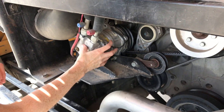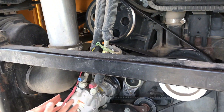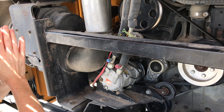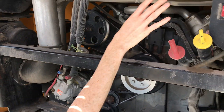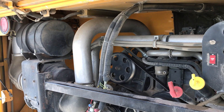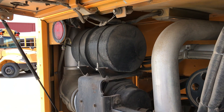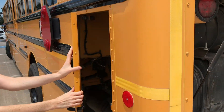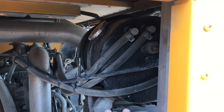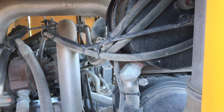While we're on the air conditioning compressors, we can also look at the hoses here — those are secure and in place, no leaking, no loose parts, nothing damaged or rusted. Also looking at all the air hoses and coolant hoses: they're all in place securely, no leaking, no cracks or damage or rust. The coolant reservoir is right here, and going around to the other side and opening this door — we check the coolant reservoir to make sure it's not leaking, it's securely mounted, no cracks or damage or rust, and the hoses connected to it are all secure and tight with no leaking.